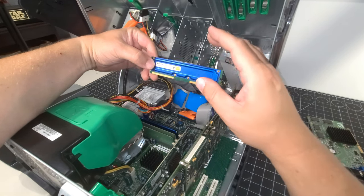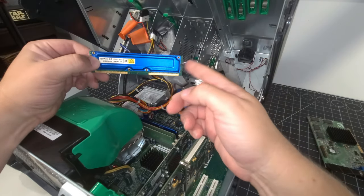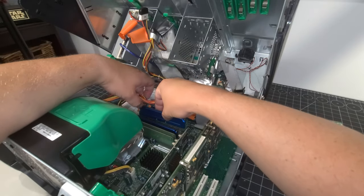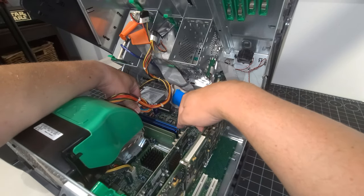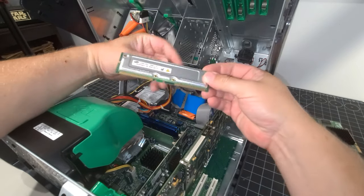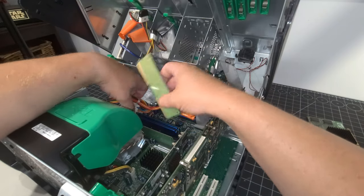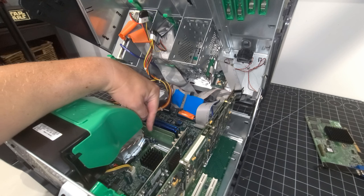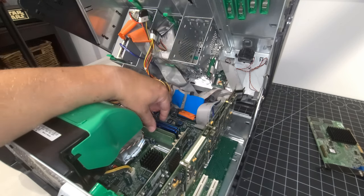We have RDRAM. From our 'Attack of the Dells' Optiplex video, I had a system I couldn't get running because I couldn't locate any RDRAM — and here we have some. It looks like two slots are populated and two are just filler chips. One chip reads 256 MB, so in dual configuration we have 512 MB. Checking the other slot — it is actually memory too. So we have a full gig of RAM. With RDRAM, all slots must be populated — the blanks are dedicated filler cards, and these are Dell branded.